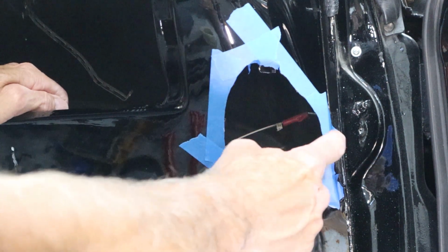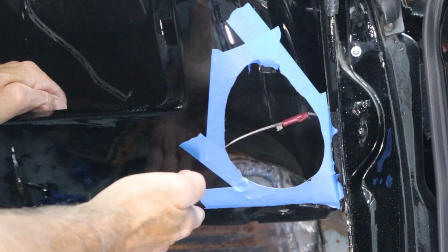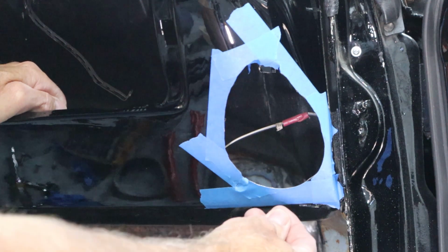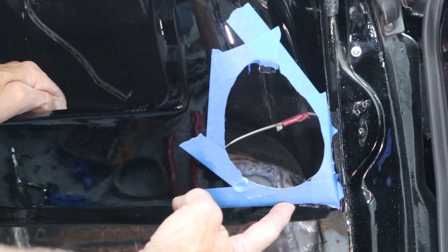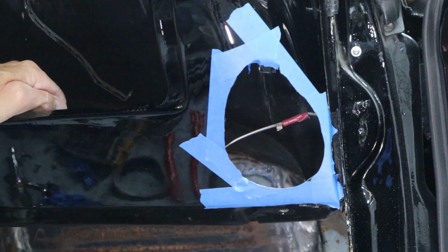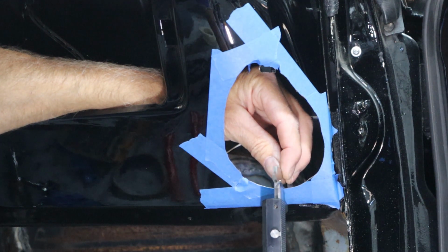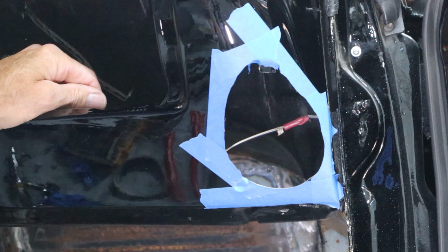So from there to there, there's 1/4 inch. And then along the bottom of the dash right here, there's a little indentation on both sides for the vent control in the kick panel. Now that measures from the bottom to right here on your cut. That measures out at, and that's just straight, not laying down, that's straight in, and that measures out at just a little, not quite 9/16.